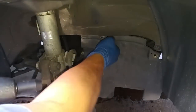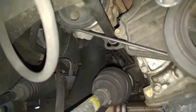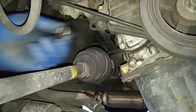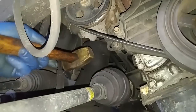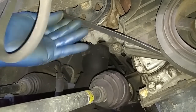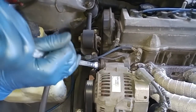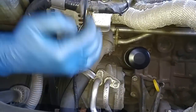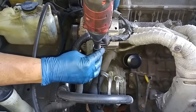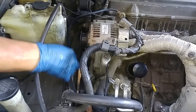We're going to start by removing the power steering belt and the alternator AC belt, so we can proceed to removing the crankshaft pulley. I'll use a brass hammer to move the pulley forward, and that will allow me to remove the belt. We'll remove the tension off the pivot bolt for the alternator, then remove the tension off the alternator adjustment bolt, and now we should be able to push the alternator down. Now the alternator belt is off.